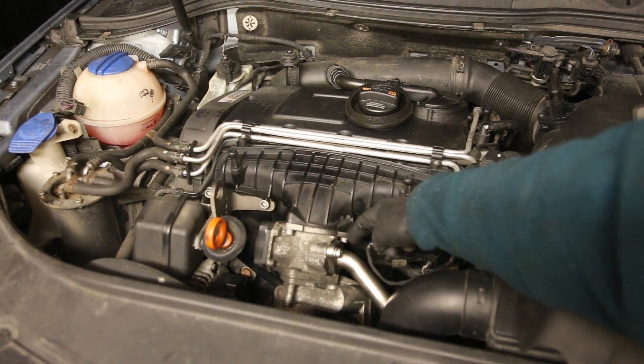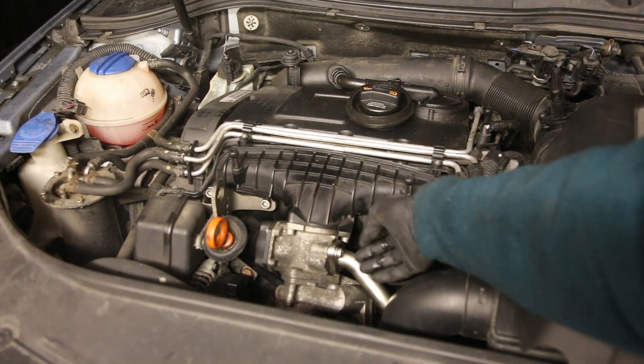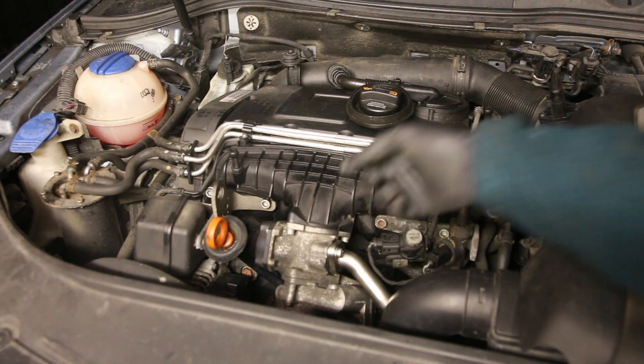You can see the important section is here — this pipe that goes down to the exhaust, and that's where we add the blanking plate in. Remove these two bolts and then you've got access to put the blanking plate in, and the bolts go through the blanking plate into the EGR valve.